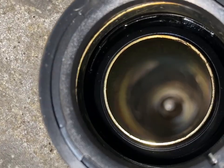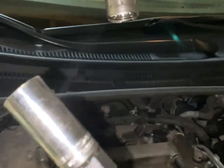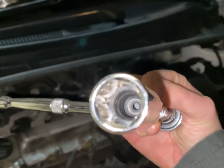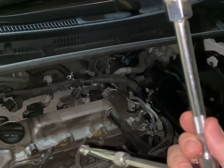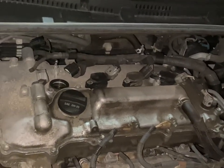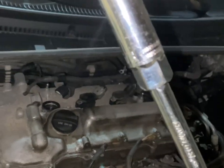Now to get the spark plug out — it's all the way down in there. What I use is a specialized 5/8s deep well socket that's made for doing this type of thing. I have it on one of my extensions. I'm hoping these are a similar depth to my 08 Corolla, because otherwise I'm going to need a longer extension. I'll attach that to my ratchet and see if we can get that little sucker out of there.